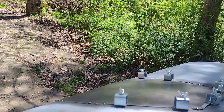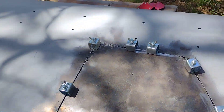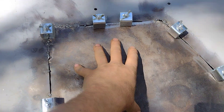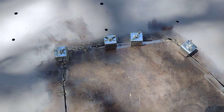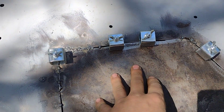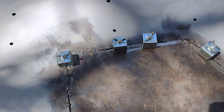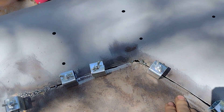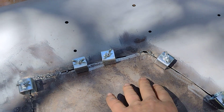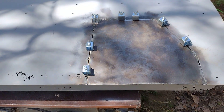That's alright, we'll fix all that, we'll dress all that. I was able to use our tools right here to pull this back out — it was mashed in, it was crushed in through here. The problem was this was low and this was high, but the panel I made was right, so I had to pull the skin to match this so it would be butt welded together here. I gotta go around it and tweak it just a little bit more. I always work on the panel to fit the skin — that's what I always do.